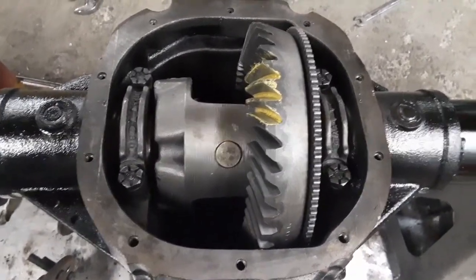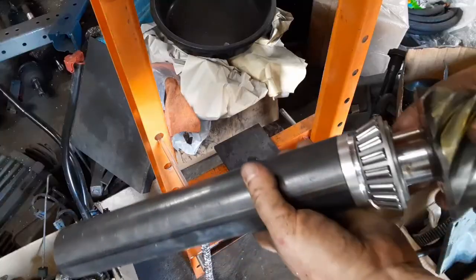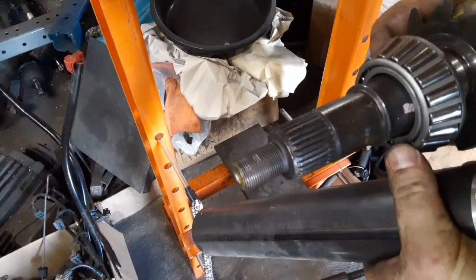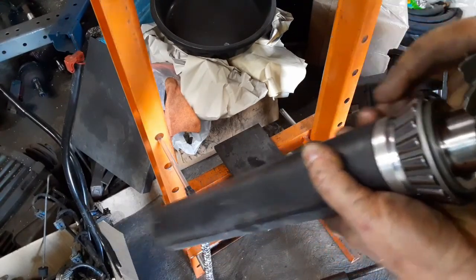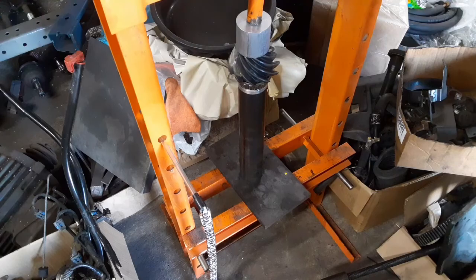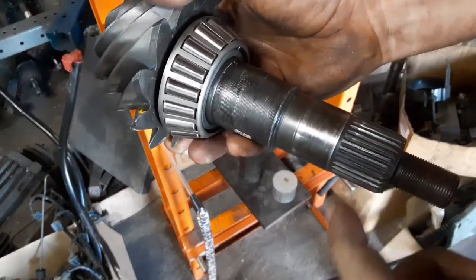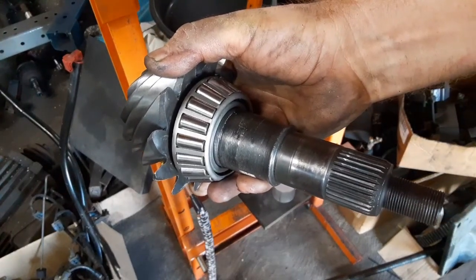On the other side our pattern looks even better - it's really centered, it's covering almost the whole face, it's not going off any of the edges. A little bit on the toe there but I've got so much face contact that I'm happy with that. So the pinion shim is good. Now I'll take it all back apart, pull those check bearings off, put the real bearings on, and put it all back together to set my backlash again. Here's the setup I use for pushing the bearing on - it's just a piece of pipe with an aluminum spacer that pushes on the race so you don't push on the cage. Make sure your shim is under your bearing before you do this. Now it's pressed on, ready to reassemble everything with a new crush sleeve, new nut, new seal, and new outer bearing.